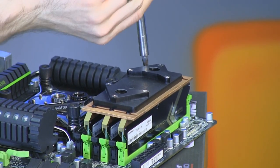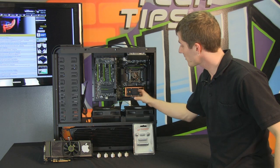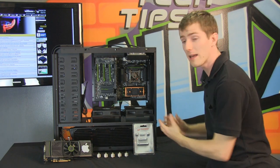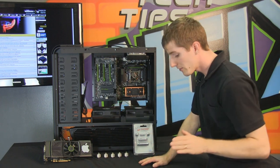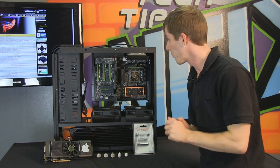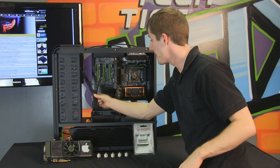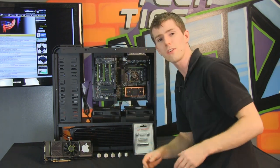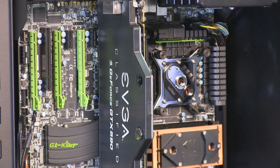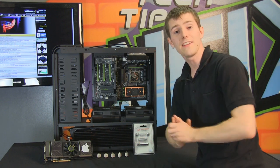Our Copperhead block and RAM modules have become one complete liquid cooled RAM unit — very solid. Now that we've got blocks installed on the board and card, and test fitted the radiator, pump, and reservoir, we can start to assemble the system. Before we run tubing, we're going to do all the power cabling and data cabling, because tubing strings everything together and can really get in the way for those other steps. This is pretty much the end of part two — in the next episode we'll cover the fittings, tubing, and actually filling the unit with water.